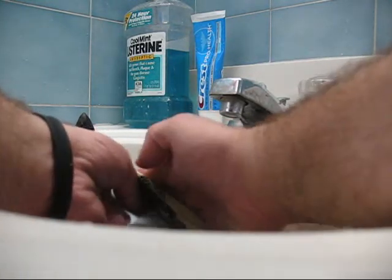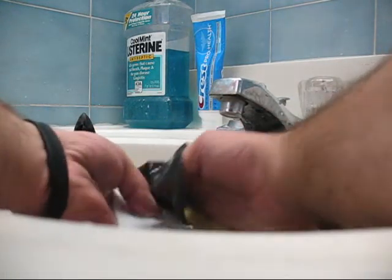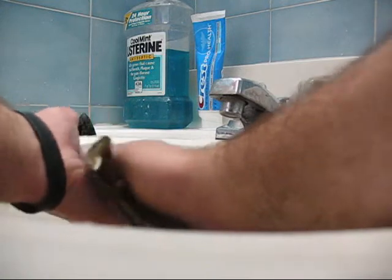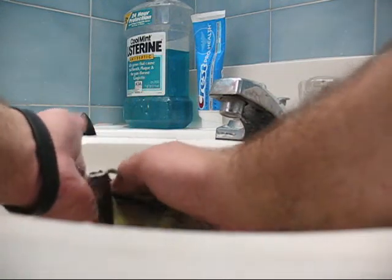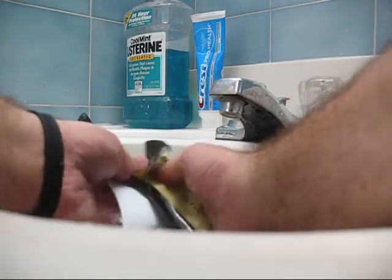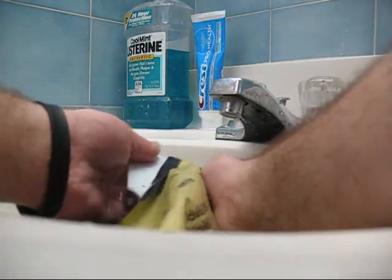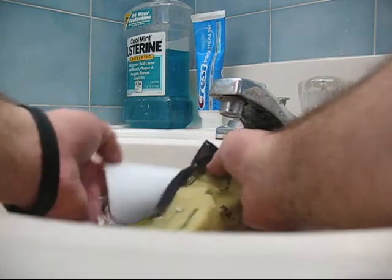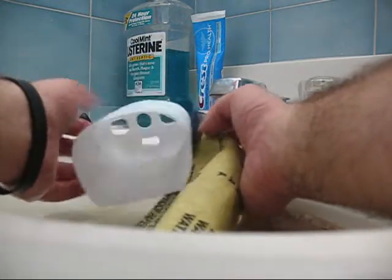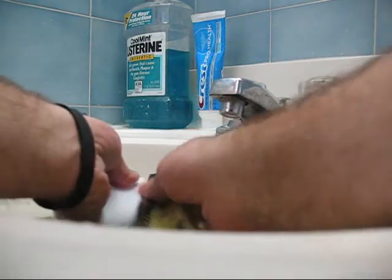Keep in mind what you're trying to do here is just remove the shine and the smooth of the surface — make it a little rough and porous so the paint sticks to it. Otherwise the paint will just fall off and start peeling. With the cowl, you don't need to do the inside unless you want to paint it for some reason. Just sand whatever you're going to paint.